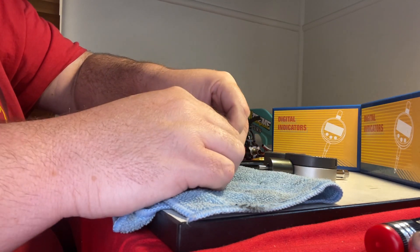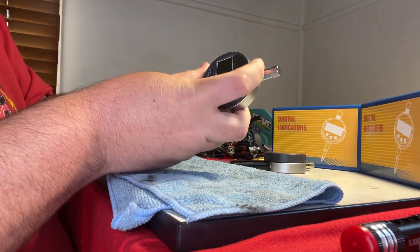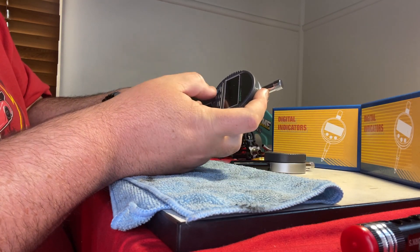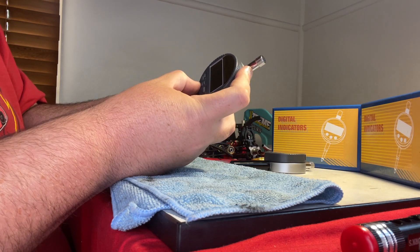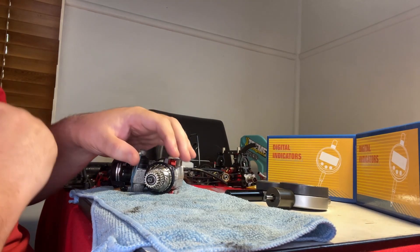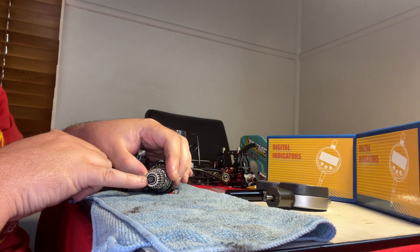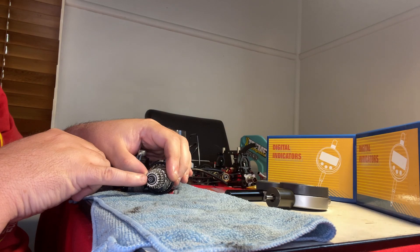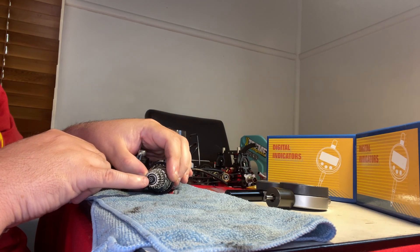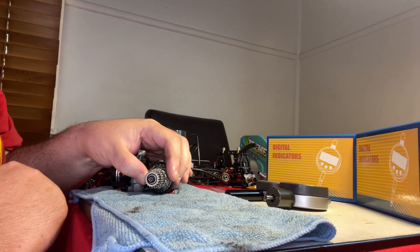I'll add a 0.1mm shim to the front of your thrust bearing, put the thrust bearing back, put your bearing back on, put it back on the clutch bell, and tighten the bolt. Now measuring again — turn that on, make sure we've got zero, go the other way — and that is our desired end float. Now that we've got the desired clutch end float, it's just a matter of greasing the thrust bearing — it's important to keep it well maintained — and I also add a drop of Loctite to the retaining bolt. Then the engine's ready to go back in the car.